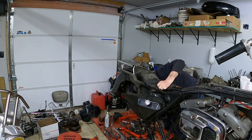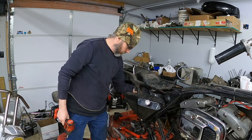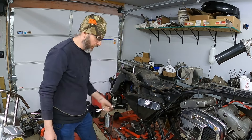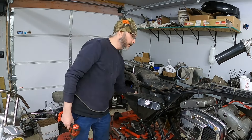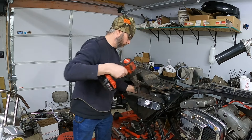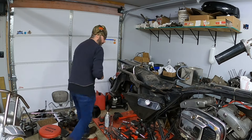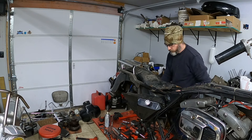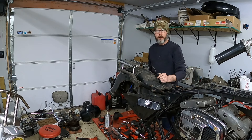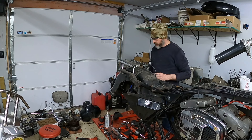Unfortunately, like most of these welded-on nuts, they do break free eventually, and the one on the bottom side that holds the fender in place is not welded any longer. So I'm going to find a wrench, get on the back side, hold it in place, and then unbolt the fender. With the fender unbolted completely, now I just have some wiring to move around and untie and unzip tie, and once those things are untied, this fender should come out.